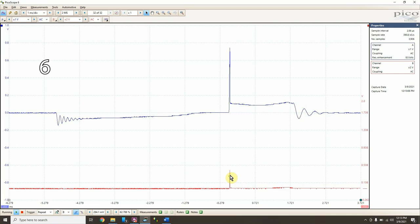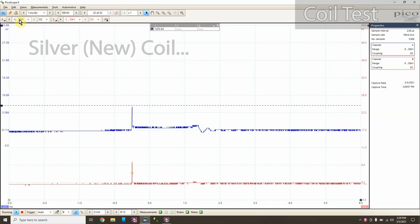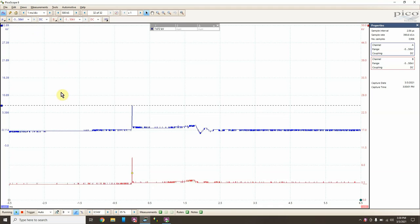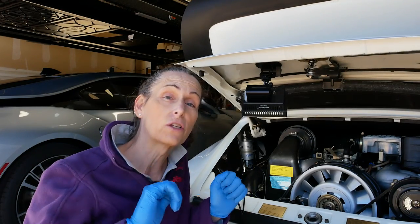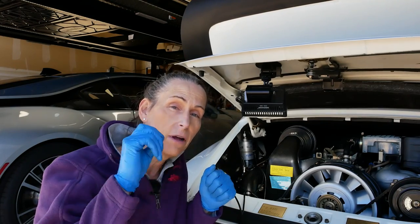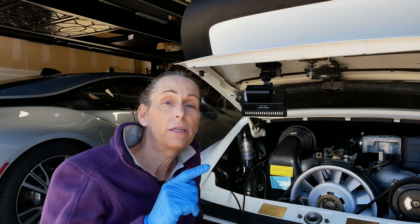Let's see if we can figure out if that black coil was actually good or not. Using a setup scaled up to 50 kilovolts — negative 5 to positive 50 kilovolts — I've got a marker here to get a measurement, and that's looking at somewhere around seven and a half kilovolts. That tells us the power of our coil, and that's not too bad. Remember that black coil we were wondering about? Now that I've got the graphs sorted out, why don't I swap out the new coil for the old one and check that kilovolt level. If it's quite a bit lower, the black coil is not so great; if it's right up there, then I'd assume the black coil is also good.